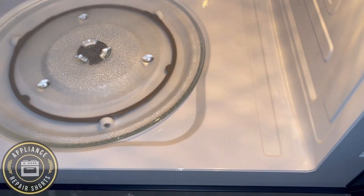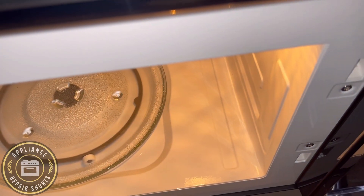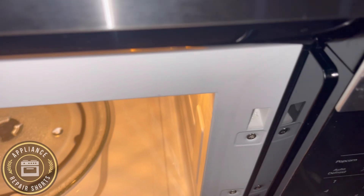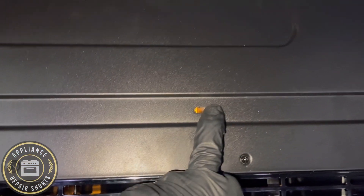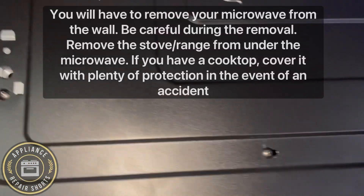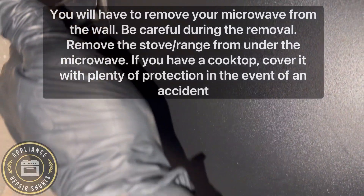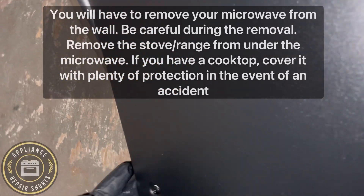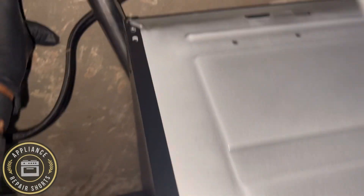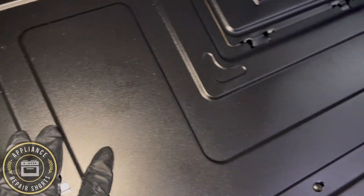Water should be nice and hot. So we're going to open this thing up and do some testing. First thing — unplug the microwave. We do have screws to remove. Pretty straightforward, but you have these up top — all these have to come out. And you do have some on the side. Got to remove those also. Underneath — some units do have screws underneath. The back as well. Okay, so one still to remove, that one as well. We're going to take this cover off and do some testing.